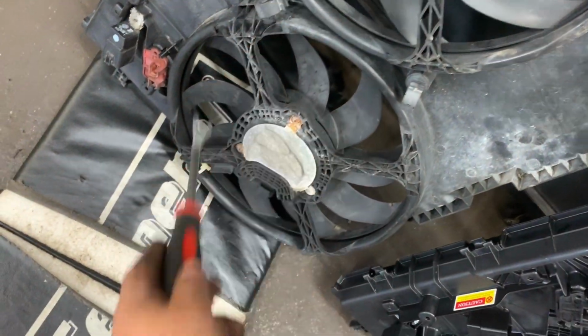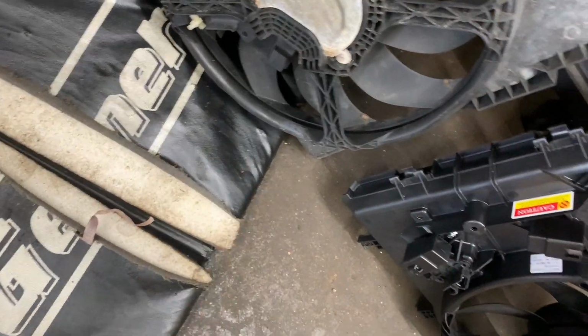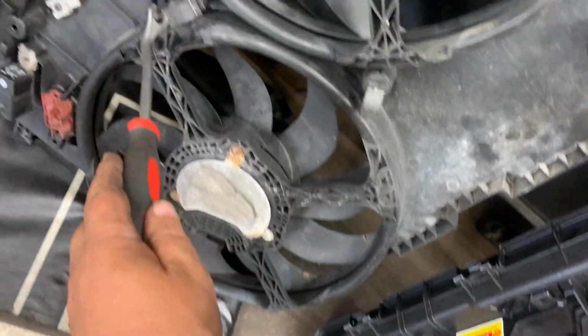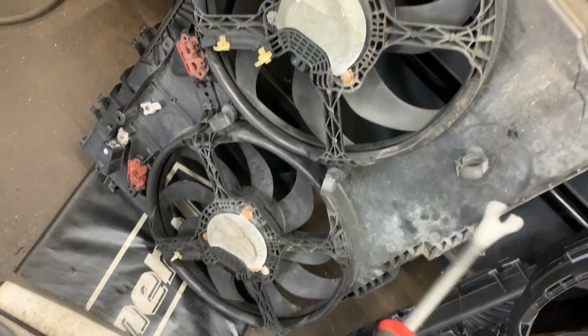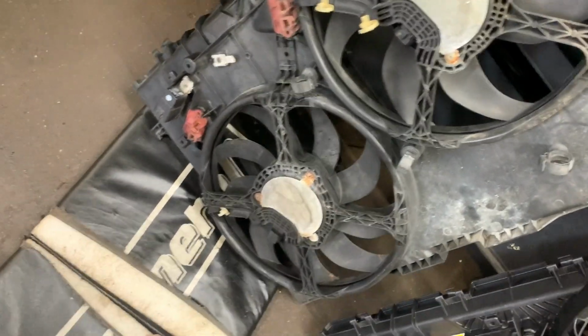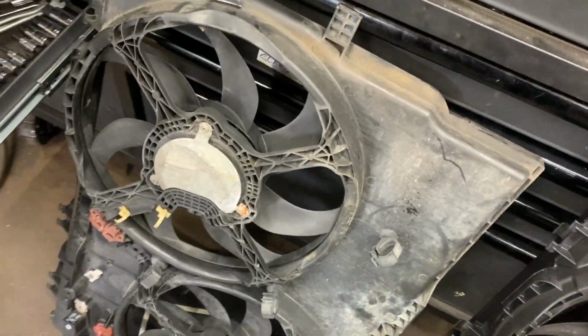I would be taking that off and putting it there, and then I'd be going around looking for these two. I have replacements for those. Same there. And these three are your most important ones because they hold this one coolant hose, and that coolant hose will fall into your catalytic converter in the front and melt and explode, and steam and fire and yelling and gnashing of teeth, and you don't want that.